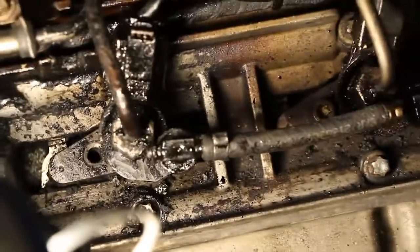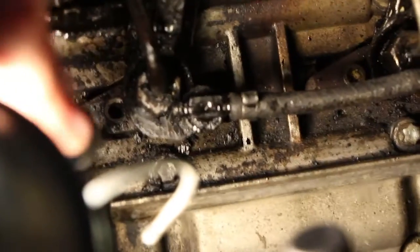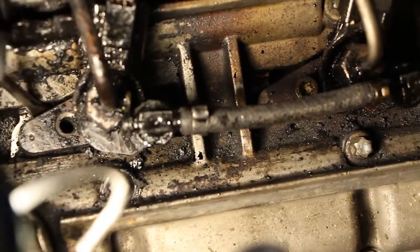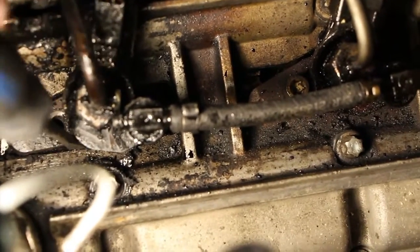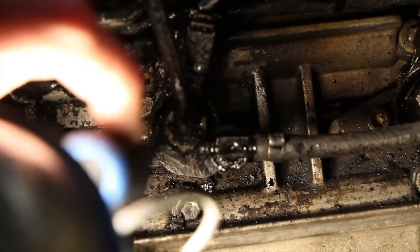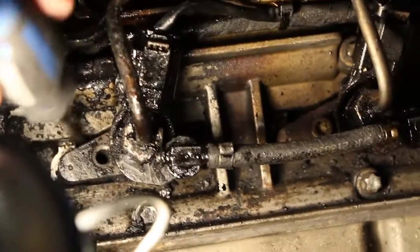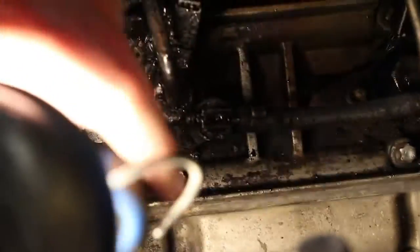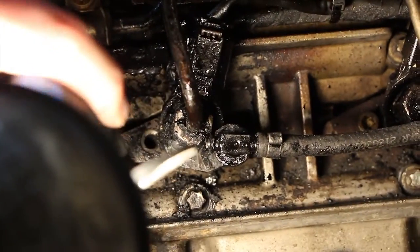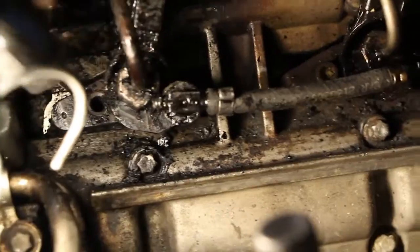With very light pressure, you're going to want to just gently nudge the fuel injector up and down. Just take your time here - very little pressure. I'm just barely putting any force on it, really just using my fingers. But you can see the fuel injector move a tiny little bit. That's a good sign. You're not out of the woods yet, but if you wiggle it around, hopefully any crud that's preventing it from coming out is going to loosen up, so when you try to pull on it afterwards, it's going to come out.